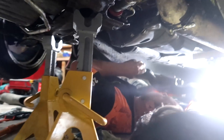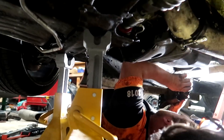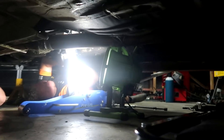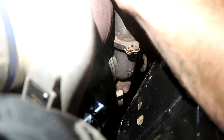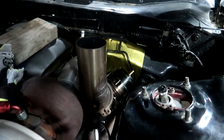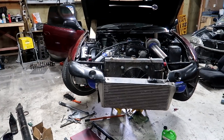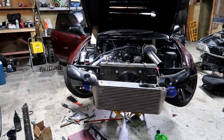After a bit of a struggle, the transmission is finally in. We solved the release bearing issue — just had to push it right back. The transmission didn't slide in as easily as we thought but it's in thankfully. Now we're putting the crossmember in, the driveshaft, and the box is in and starter motor is on. Just putting this 60mm wastegate on — very tough schematics here. We need to line it up so it faces out the hole in the hood. After much anticipation it's finally come time to try start this thing for the first time and see if she's crook or not.